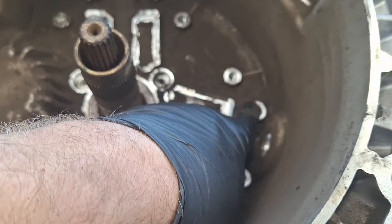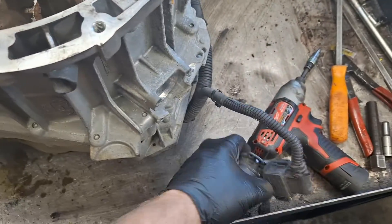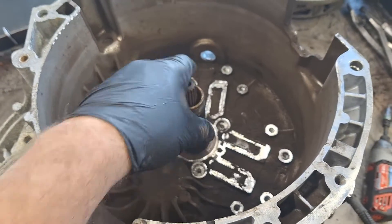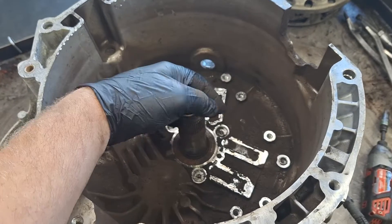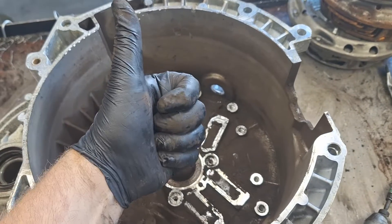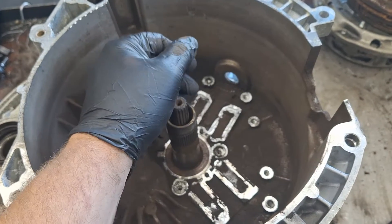The dowel pins are there. They're going to get a clutch, the forks, the slave cylinder, and actuators while I'm in here, plus a fluid service — two quarts of XT11, takes 1.75. Teardown inspection of a Ford Focus DPS6 with a P2700 trouble code. Have a great day, thanks for watching. I have a playlist of other Focus Transmission videos to help you out.